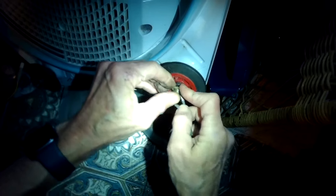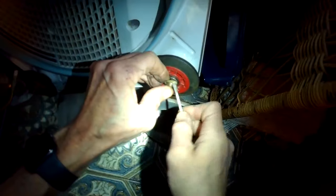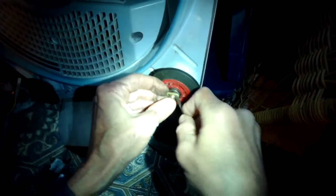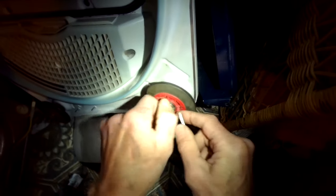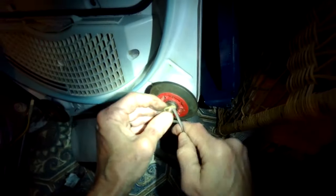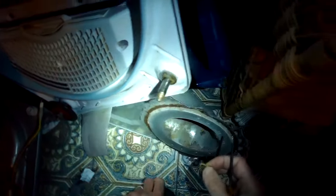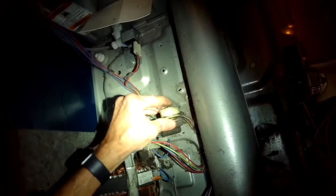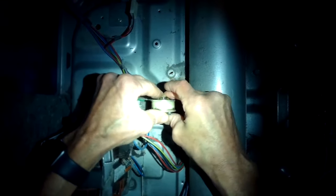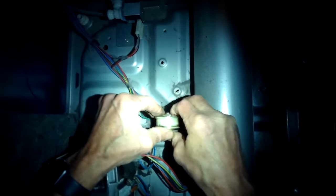We get the support wheel off the front — this is on the front panel, on the bulkhead. We're going to pry off this plastic piece using a standard head screwdriver, then pull the wheel straight off and clean the shaft. This one doesn't require any lubricant. We're putting the little plastic retainer back on the idler wheel — it just snaps on. That one's all done.